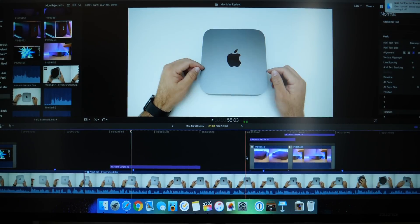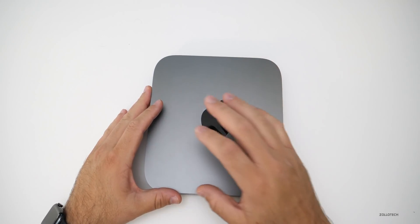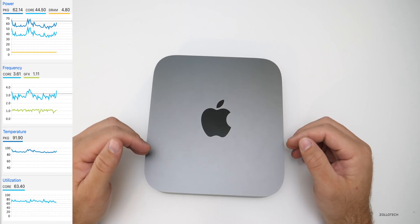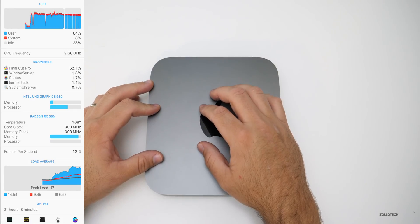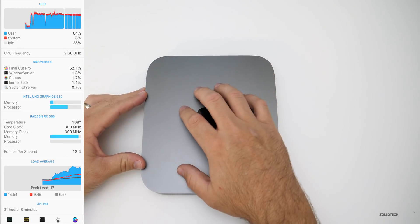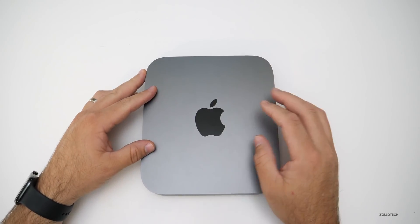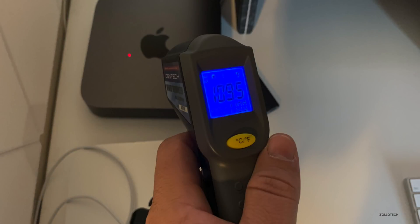I did all my editing in Final Cut Pro and while using the timeline there are no slowdowns whatsoever — it's super fast. One thing I was really impressed with: even when exporting video there's no thermal throttling below the base clock of 3.2GHz. I did see it bump up a little with turbo boost and come back down as expected. However, even with the chipset hitting 90 to 100 degrees, it maintained base clock speed. My concern is long-term reliability — Apple is known for hot thermals, and the surface of this Mac Mini runs at about 110 degrees, so it's really warm all the time.